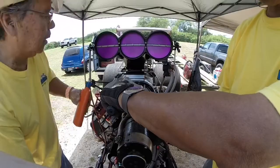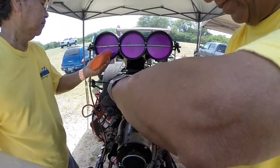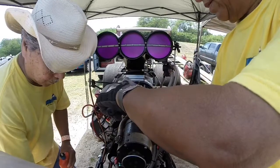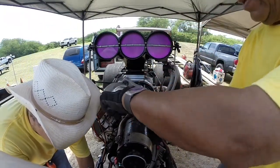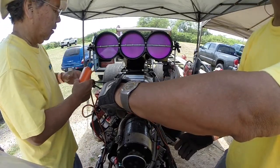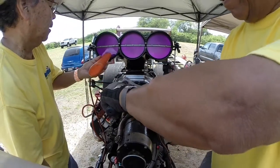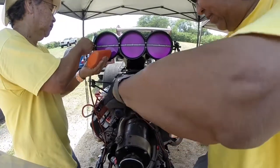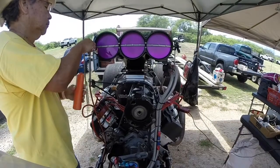Here's another situation — crank it and feed, but this is the Hemi so there's probably not enough fuel and it died. In this car I don't have any control over the ignition, so Bobby is going to pull the mag wire, close the wire, then you just feed. This time it lit and stayed lit.